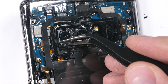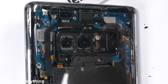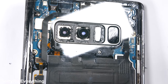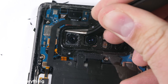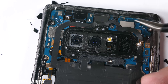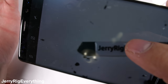Each time the lens cools down the adhesive will get hard, so I'll just warm it up again. It's a rather tedious process because I'm taking special care not to let the glass fall into the camera unit. The camera has optical image stabilization and a focus mechanism that requires movement, so getting glass jammed up inside the Note 8 camera unit will keep things from moving and working like normal. The exterior glass we are installing has nothing to do with focus — just protection. All of the focus and stabilization happens underneath the glass. All of the glass dust, shards, and adhesive needs to be cleaned off from inside the metal camera lens frame. Any dust left will become a pressure point for the new glass and might cause it to break when pressed into place. I'll flip the phone over and give it a couple of sharp taps with my finger to help dislodge any dust caught inside the camera unit.